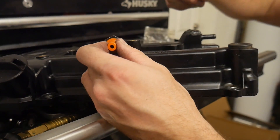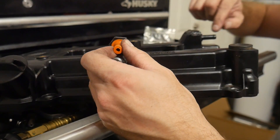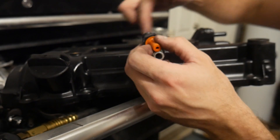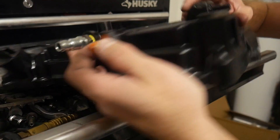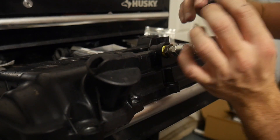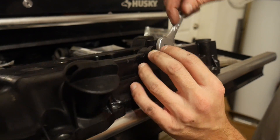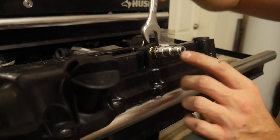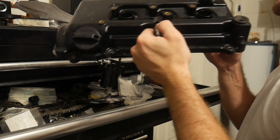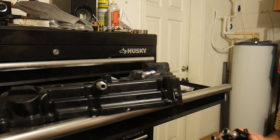We're talking about emissions and fumes from the engine. It's creating a negative pressure, which is what you ideally want — drawing in from this side and pushing out through here. When we start getting up into high horsepower, that little ventilation is not going to be enough to support the turbo. So we're widening this thing up — I just found a couple of fittings. That's going to flow much better. We'll get it hooked up to an oil catch and that'll be that.